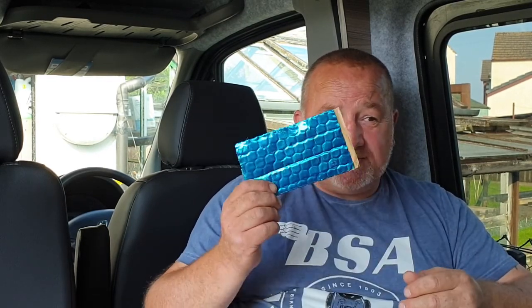A lot of people ask: if you're insulating here why are you spending money on this product and adding additional weight? Well, this dodo matting is 50% of the weight of the original product — it's a lot lighter, only 2mm thick, and that's where you save weight. But the fact is this stuff works really well. Same as the thermal liner — I would still use insulation. You'll see in future videos where we use this matting on the bulkhead, put a vapour barrier over the top, all just for sound deadening.